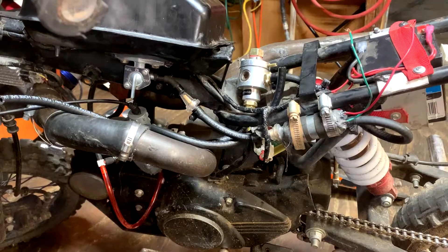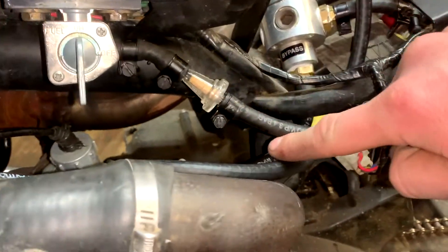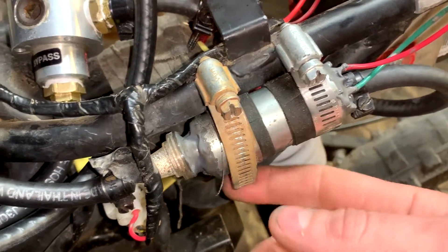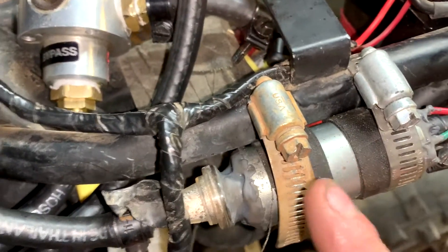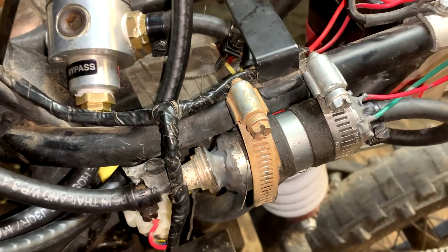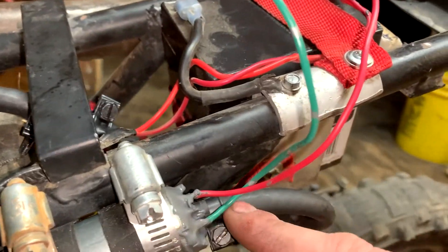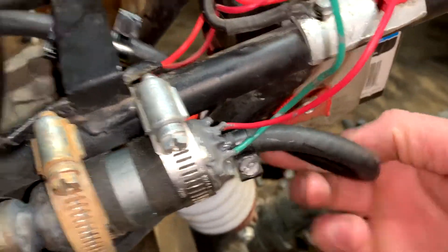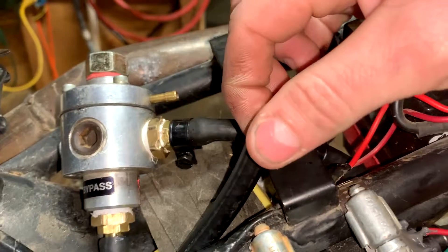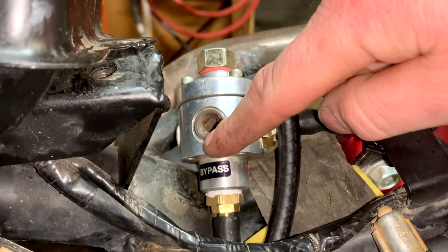Here's what I've got going on so far: I got the petcock valve put in, a fuel line going to a fuel filter, then another fuel line going to another fuel filter that is JB welded to a fuel pump - this is a Ranger fuel pump, an in-tank fuel pump I turned into an inline fuel pump because it was a lot easier to do it this way. The output pressure line goes out to the fuel pressure regulator, and before the fuel pressure regulator there's a T that goes down to the carburetor, so the fuel is regulated right there.